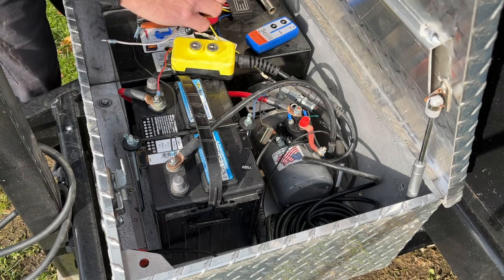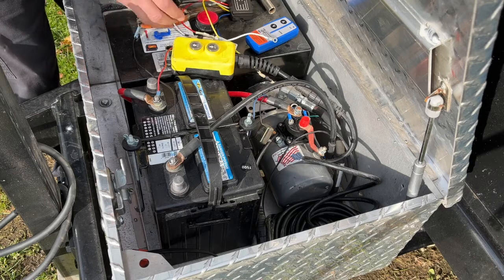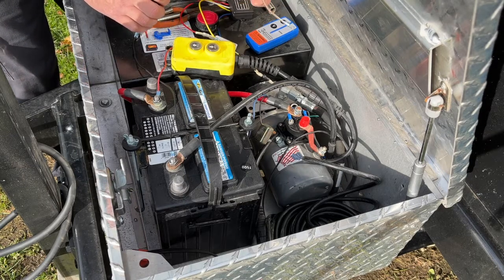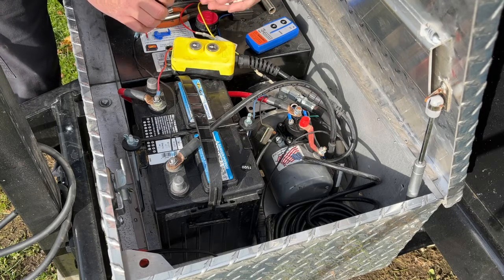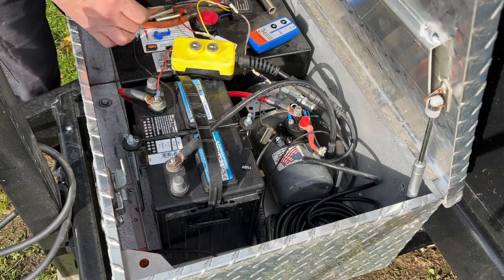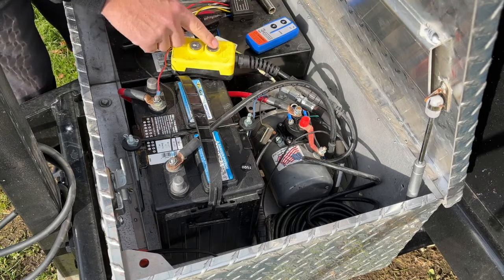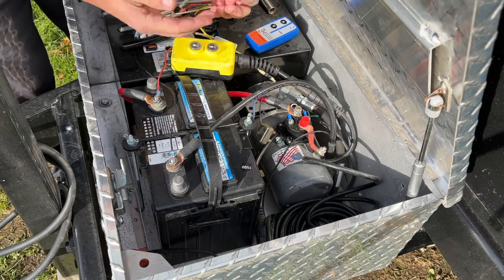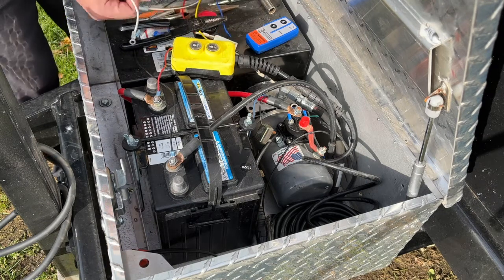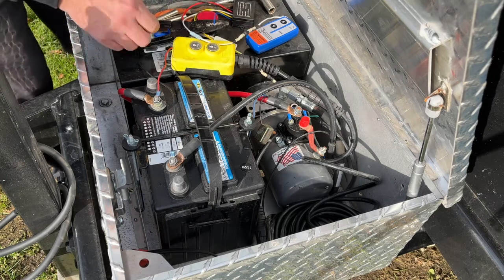And what I was saying about those diodes, they install one specific way because the power flow only goes one way. So when you install that, just be cautious about which way that goes, because like I said, it stops any backfeeding of power. So that way when I go to use my standard controller, because these will be shared with those same ports as this remote, you want to make sure that when you push this button that 12 volts isn't coming back up into these lines and going into your wireless controller. I'm not sure how well these are built, so you just want to make sure you don't backfeed any power into those. All right, so our butt splices are done.